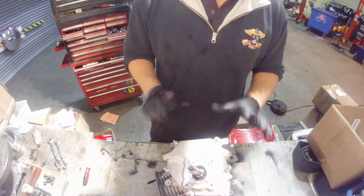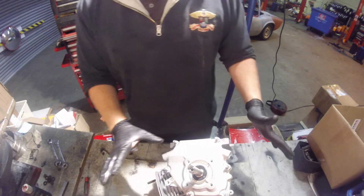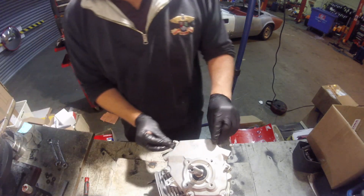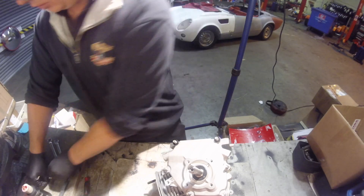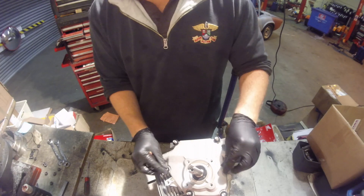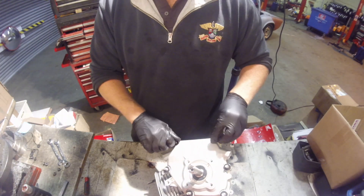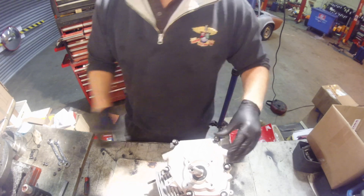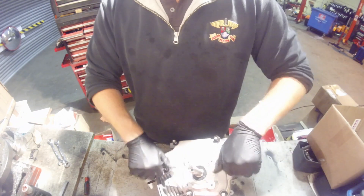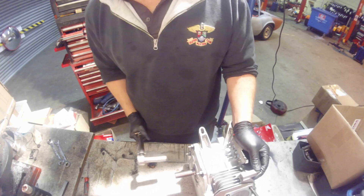On the website we do lovely billet covers, but for this purpose we're just sticking with the standard engine. Then put on the washers from your stud kit and six nuts. Going round each one and torquing to the correct torque.